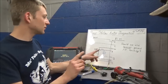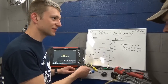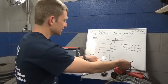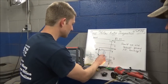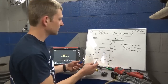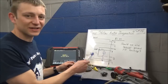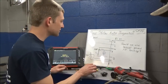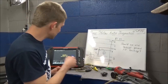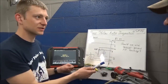Here's where we can get into trouble. Where are our leads connected on the voltmeter in this case? Our negative lead is connected to the negative of the battery. So actually, instead of being across the sensor, we are connected to the battery. This is exactly what could get you confused. If you measure across the signal and the sensor ground, which is disconnected, you would see zero volts. Right now we're reading five because we're actually measuring from the five-volt reference to battery ground, and that makes sense.